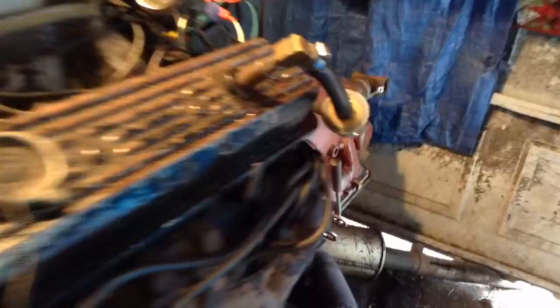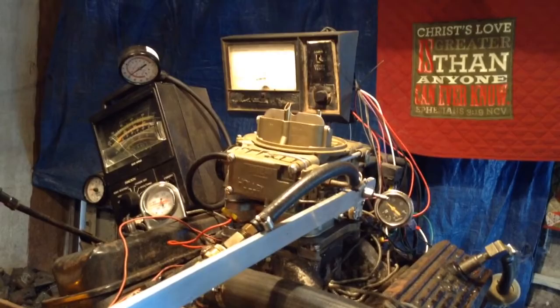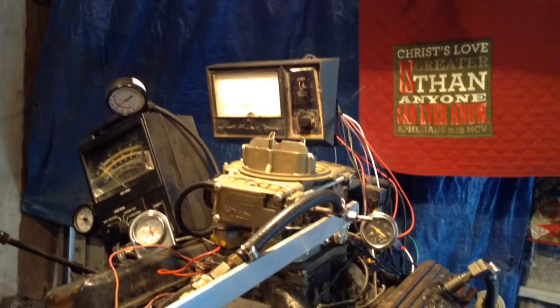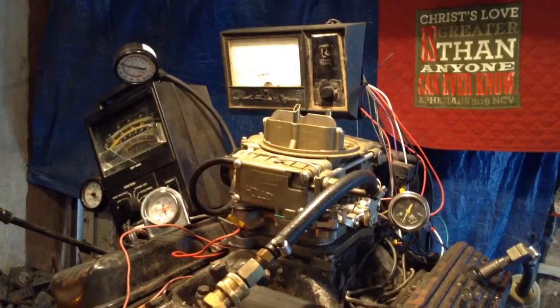Take it out of gear and we'll give him a free rev. If you change your mind on electric choke, it doesn't have to come back out here on the test dyno. It's been fully tested, road tested, full load on it — I think we put about a 10,000 pound load on it. The carburetor doesn't hesitate one bit. You've got your good vacuum readings for your vacuum advance. Watch the videos, read all the instructions, and you'll have no trouble — it'll run perfect for you.